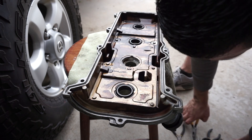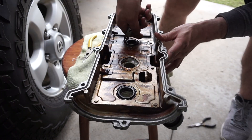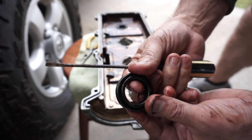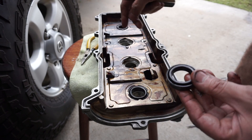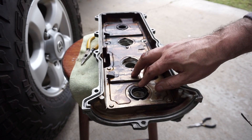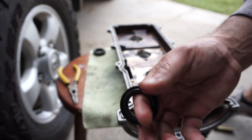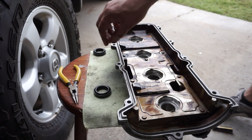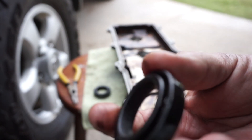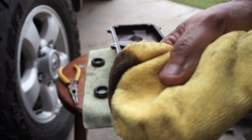Now we can do all the other ones. Remember which way you pull them out so you put the new ones back the same way. I've removed all the plugs and the circular gaskets for the plugs. The flat surface goes down and the little indentation goes up. I cleaned everything out using some brake cleaner — put it on the rack and wiped it around. Now it's time to open up the new gaskets and put them in.